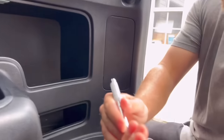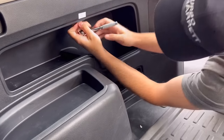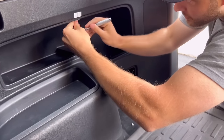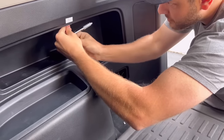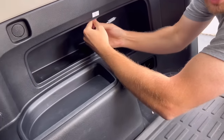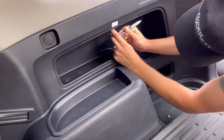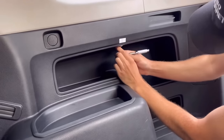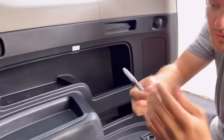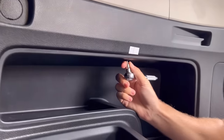With this alignment sticker, just pick your spot. I've got the self-tapper in the socket - you're just going to put it on the spot for the hole, work it back and forth. If you have a ratchet that works, just work it back and forth - you're essentially drilling just this little pilot hole while applying pressure upwards. Once you pop through, go a thread or two and stop. Sticker out - these are ready to rock.